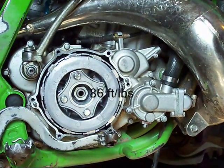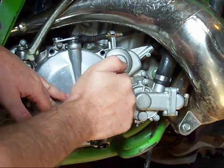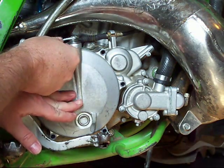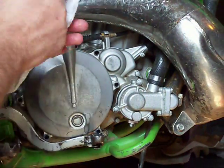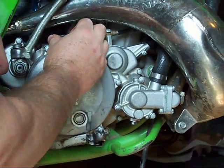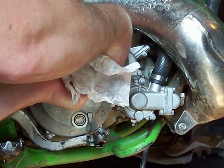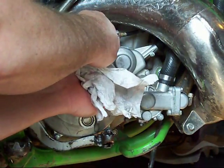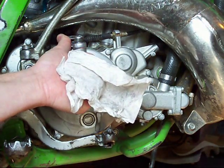So here's the pot we want. But as soon as I seat it, this thing is sitting way back too far, so that when it's fully moved, it only goes so far. I can make this cable reach, but then this is pulled in all the time — fully engaged or disengaged, I don't know which way you'd call it. I guess it means the clutch would be fully disengaged. But that's all the time — I got no play, no adjustment, no nothing.